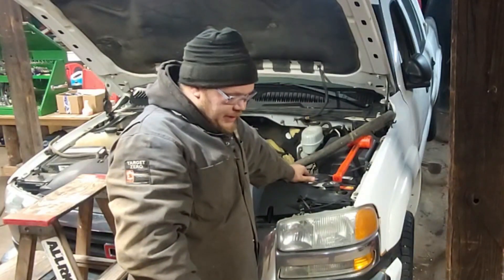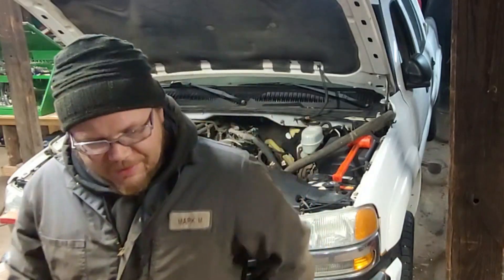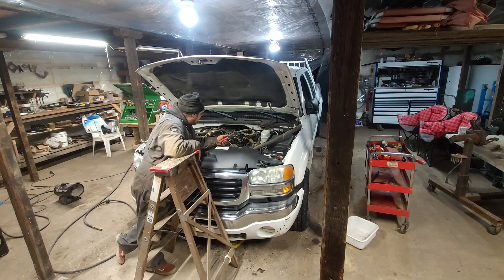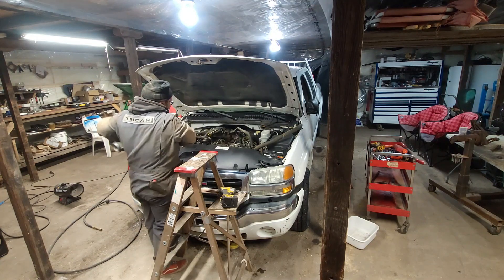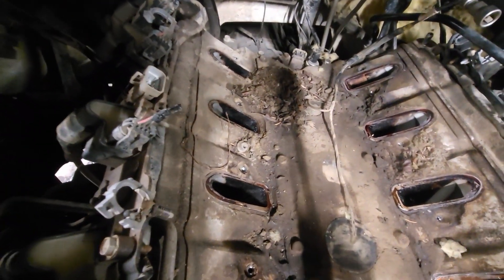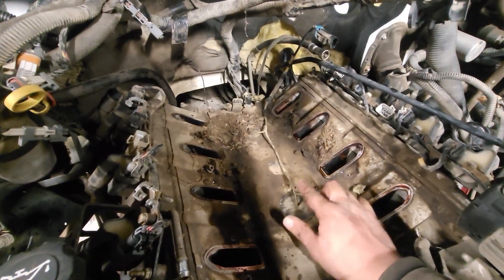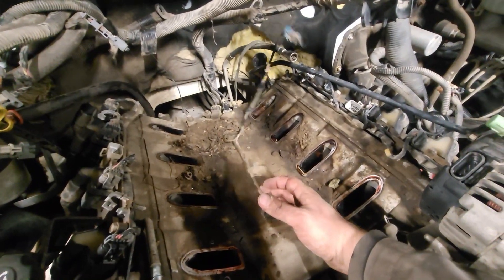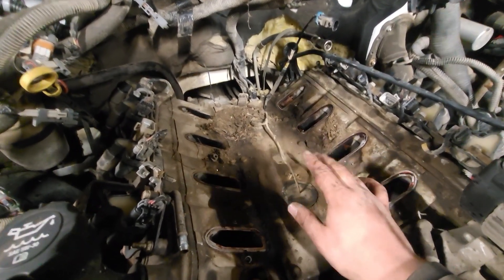The next part is the AC and we don't run the camera for the next part. Every time I think I'm almost done I realize there's like six more things to do — I forgot I gotta pull the intake off. That's what made undoing that top bell housing bolt easier; next time I'll do that to begin with. Gross — that's disgusting in there, look at how gross it is — we've got dirt like crazy, we're going to have to vacuum this out. I did not have to remove that intake manifold because the knock sensors just go to there. I definitely could've just undone those two sensors back there and it would've been fine, so that's kind of a waste but oh well.